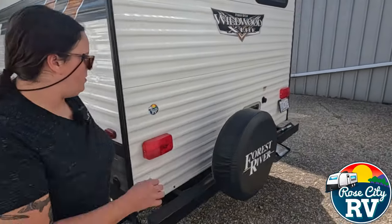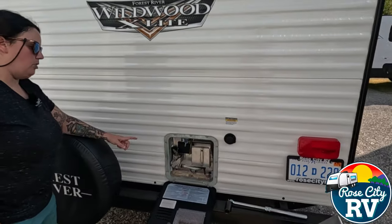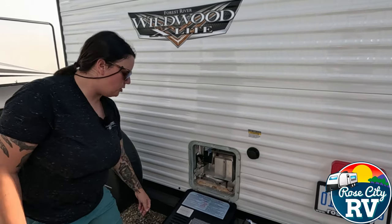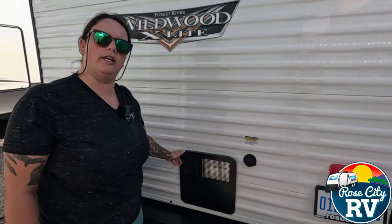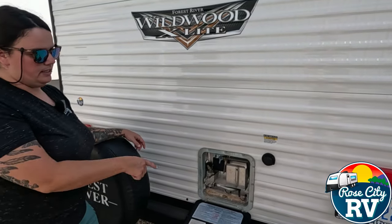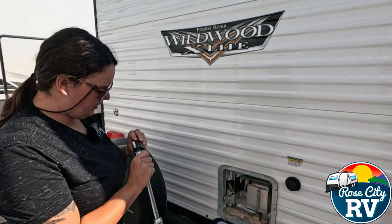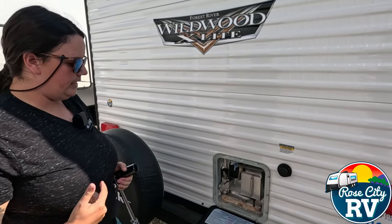So I'm going to open those and drain the fresh water. Second thing I'm going to do is come over here to our water heater. You might ask yourself, what does my water heater look like? The majority of them look like this — and I say majority because there are multiple different kinds. This has a Suburban, with an inch and a sixteenth socket. I'm going to drain this down and let that water come out of there.